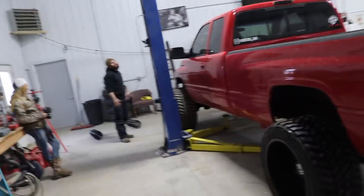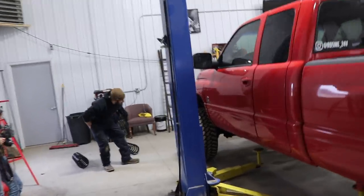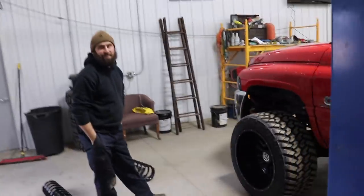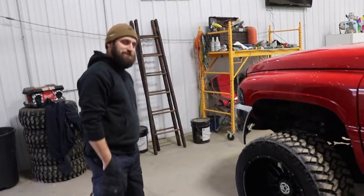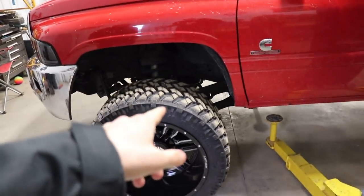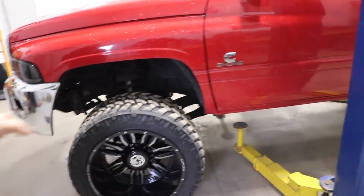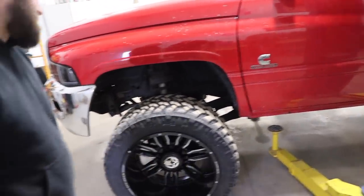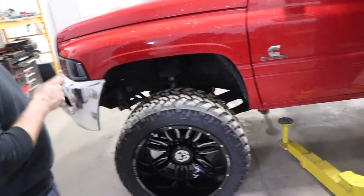We're gonna — well, when I say we, I mean Devon's going to be installing a five-inch lift kit. We're gonna revive the Dodge. This thing almost fits, and Devon was telling me how you could run this setup on this truck and daily drive it without many rubbing problems if you put adjustable ball joints in it. Would you still put the upper and lower control arms on? The extended ones that push — because if you look at the gap, there's a lot more room in front of that tire than behind it because of that leveling kit.